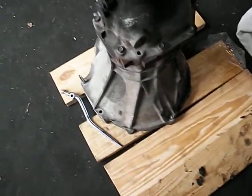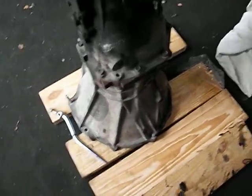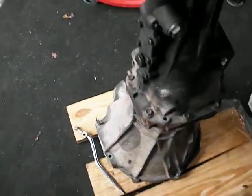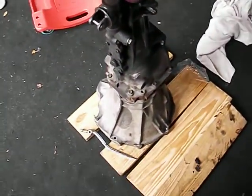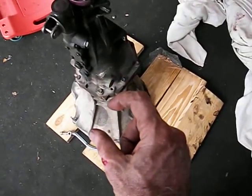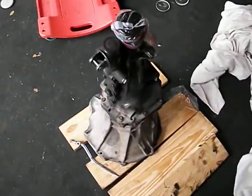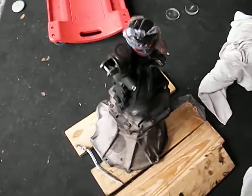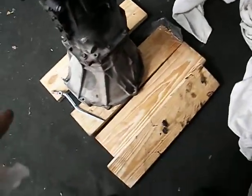Rotationally, to match up with all the other alignment details. Plus, it just takes all the load off — you can just take a break and grab it and shake it. While it's still on the jack stand and you've slid it into position and got it started on those pins, just grab it and wiggle it while it's still attached to the jack, and it'll work its way into the pilot bushing without any big deal. That's the tip.